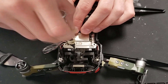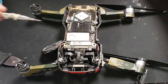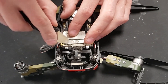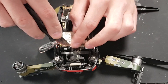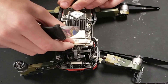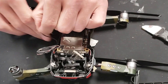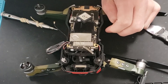Once you remove that you're going to be able to see the four ribbon cables connected to the main board. Go ahead and disconnect the four up front. There's going to be one connected there, another small one right beside it, a larger one — and be careful with this larger one, there are two metal brackets that are kind of fragile, so if you break them you will not be able to get this back on. Be very gentle with that one. Once you get those four up front removed, also remove both of these antennas. It's fairly fragile stuff we're working with.